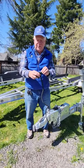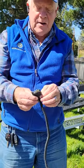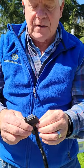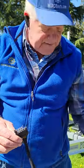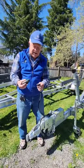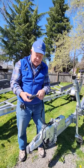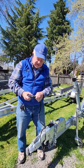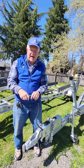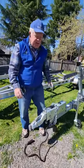This is a flat 5. Most small trailers will have a flat 4. This adds a pin which has a blue wire attached to it. When that gets 12 volts from your car's backup light system, it operates a valve in the back here and disables the brakes. This is plugged into what's called a 7-to-5 adapter so that you can plug this into your regular car RV adapter. You can plug it into a 7-to-4, but then you don't have the brake lock disabler, which is important and I'll explain why.